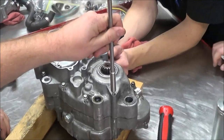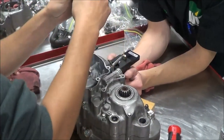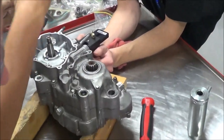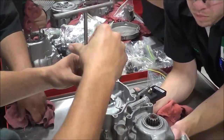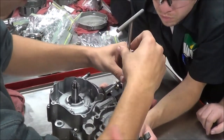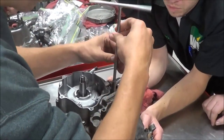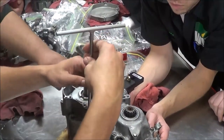I think you're ready to rock and roll. Let's snug this one down — I'm a big fan of a T-handle. Just kiss it and go all the way across in a pattern. We'll look in the manual to see if there's a specific torque pattern. They've got a torque wrench ready to go and they're going to torque this to 78 inch pounds — that's a 6x1 bolt, a typical fastener that does 6 to 9 foot pounds. Especially on older bikes, those bolts have been in and out numerous times — you really want to check them for necking. If you don't know what a necked fastener is, go to our measurement playlist; we have a video there that talks about necked bolts and how to inspect fasteners.